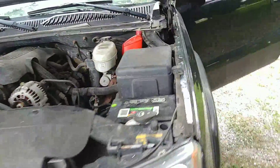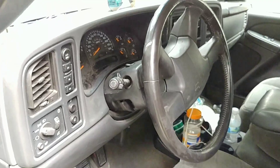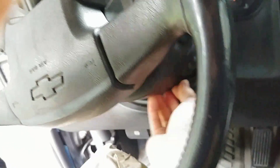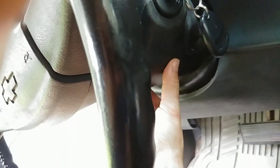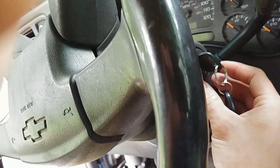But yeah, it ended up being a fuse under here. A lot of videos out there are about 30 minutes long so hopefully this one's really helpful to you guys. Other reasons that are very common for Chevys to not start is the ignition control module, which is located right under here — it has to do with your key not being sensed in the right position and all that. Very common part to go bad.